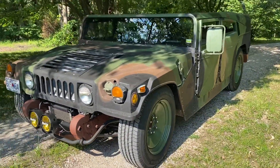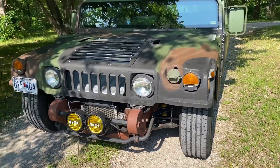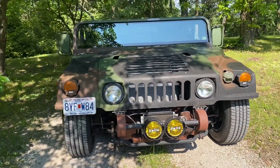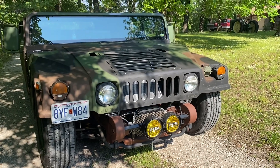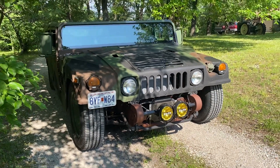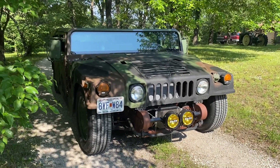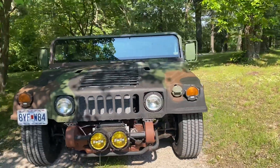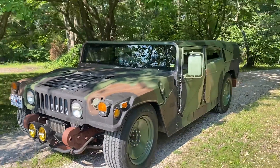For those of you who checked out the video from earlier today, I got those drop spindles in, put stock springs in it, and put some new shocks in it. Wow, it's just incredible — it's a different vehicle. It's about an inch higher than the way it was before, but I'm going to leave it that way. I decided it's probably more practical than being dropped to the ground.